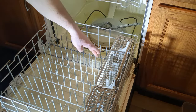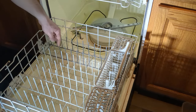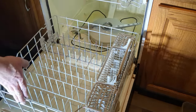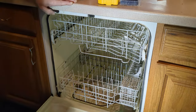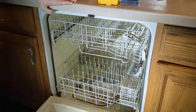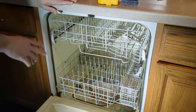I'm reinserting the bottom rack as well. By the way, I've ordered replacement rungs online — if any of your rungs are breaking or rusted out, these back ones on the tray are actually easily replaceable. I'll leave a link to where you can find replacement rungs in the description. Now I'm going to run the dishwasher with some dish soap and no dishes, and this particular model also has a sani-rinse option which I'll run as well, just to give it a good clean out. After that, do a trial run with your dishes and see if they come out cleaner, and hopefully everything's draining well. Keep an eye on it during that initial wash to make sure nothing's leaking and it's draining correctly.